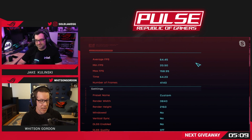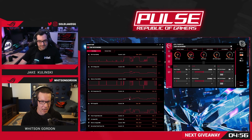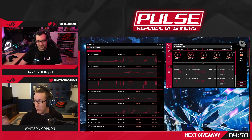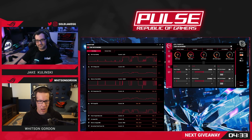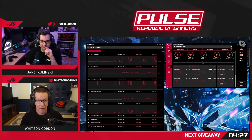Noise levels are not actually an issue for me on this TUF card, to be completely honest. Even when we were running it overclocked, this thing was like 65 degrees — it got up to like 60 — and the thing is just silent. Even running this thing at 500 watts, the fans barely spin up. This card blows my mind. Even if you're just a silence nut, here you go. This is why we built this incredible cooler with the vapor chamber on this card — because even if you're in performance mode, even if you're overclocking the snot out of the card, you are not going to have very much fan noise.